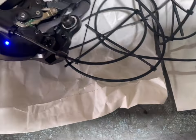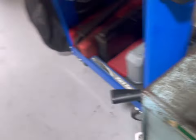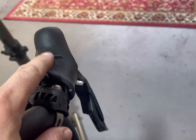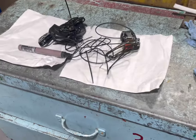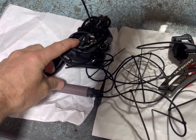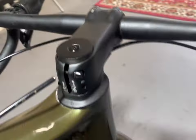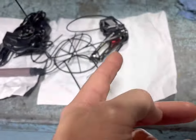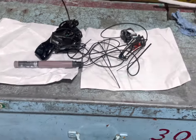So now that we have a little bit of charge in the battery, I've connected it up. Basically here's your button — you click and hold it until you get this flashing blue light. Now we're in connection mode and we can connect it to the levers using the eTube app. Using the eTube app was relatively easy — you click and hold until the blue light's flashing, then you're in connection mode, connect it up, and scan the QR codes on either shifter. Relatively simple. Now checking that it's all working — we've connected the front derailleur and rear derailleur, and the shifting is all good on both. So we'll start putting it all in the bike now.